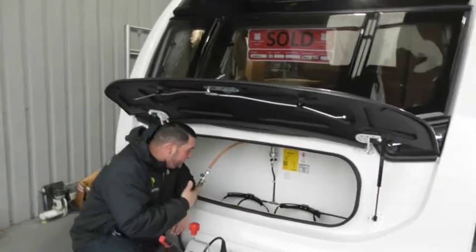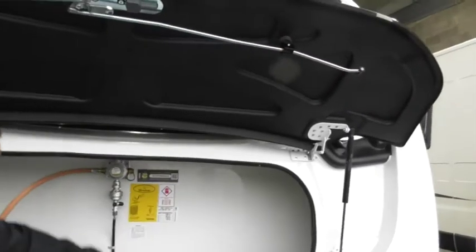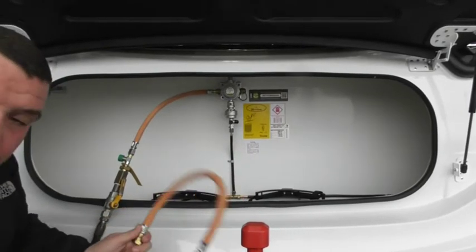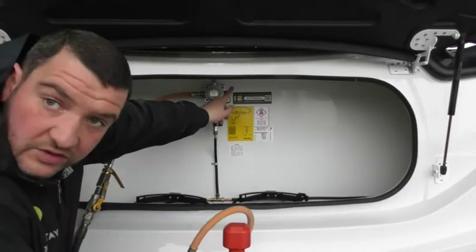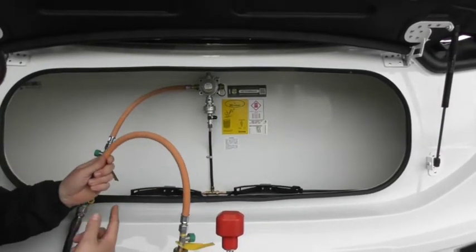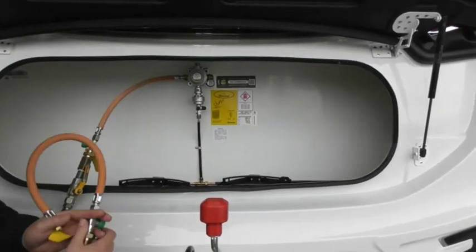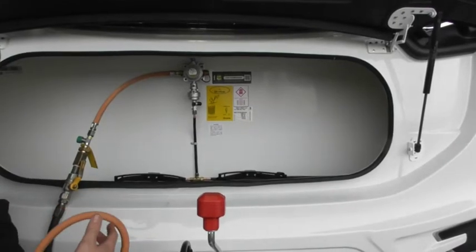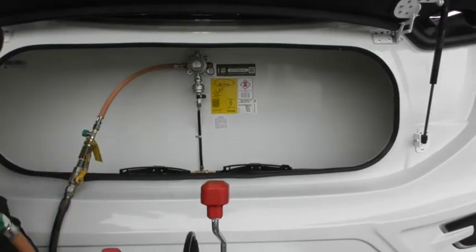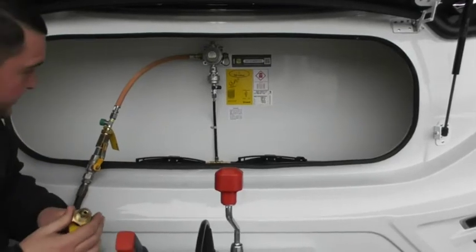You never know though. So moving into your gas locker at the front now, I'm glad you brought the 2 bottles, because with the Celeste it comes with the changeover and your 2 gas pipes. Super. But all it is, always have either 2 bottles on or blank the other one off. Okay. Don't ever have just a pipe on with nothing on the end. Okay, so it's either 2 bottles on or 1 pipe. What about when one runs out then? That's fine, just leave the bottle connected. Okay. Obviously when you're changing it's not a problem. Yeah. But don't run your gas system with 1 bottle on and 1 not attached. Yep. It's fine if this is attached. Yeah, all it is, imagine if that's open and you've got nothing stopping anything, so always make sure you're attached to one or the other.